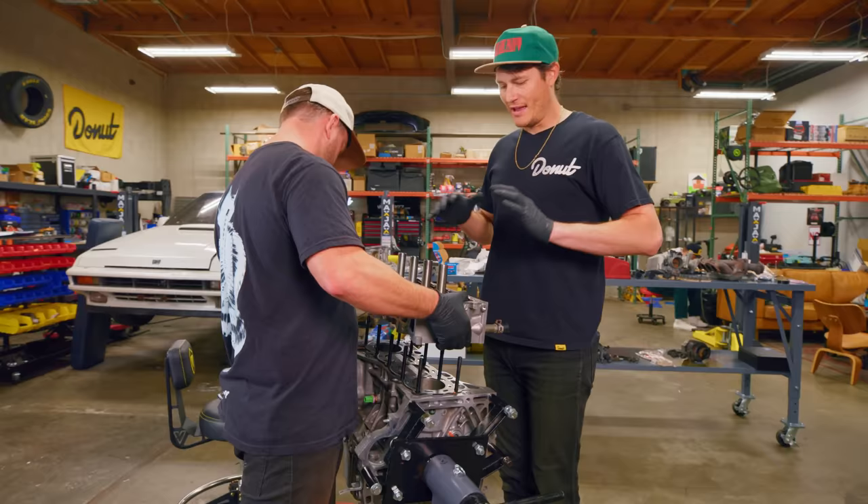Something very interesting about this engine is that it has i-VTEC. You've probably heard of VTEC, but i-VTEC — the 'i' stands for intelligent. On the camshaft, underneath, we have our rockers. These rockers give us essentially two different cam profiles. At lower RPM, the cam rotates and hits the two outer lobes. But after you reach a certain RPM, oil pressure connects the three pieces together and the center cam lobe — which has a more aggressive profile — pushes down, giving you longer lift and a bit of extra timing, allowing for more power. When you're just cruising around town, you use the smaller profile — so you have a nice, fuel-efficient inline four-cylinder.